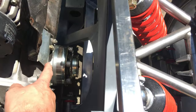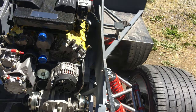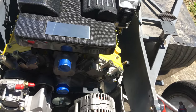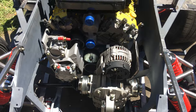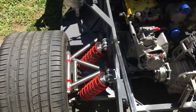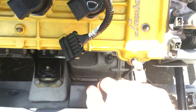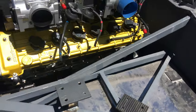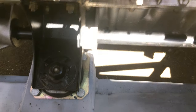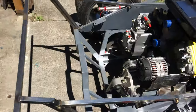The second issue was a gusset underneath the rear diff that I had to cut out — no big deal. The third issue, which also didn't affect the installation process, is that the crossover bar will be obstructed by the power steering. The final issue was that the bolts for the motor mount line up directly on top of the bottom lower frame, so getting those in is a little challenging. But other than that, the fitment is really good.